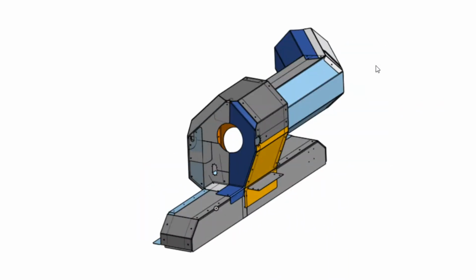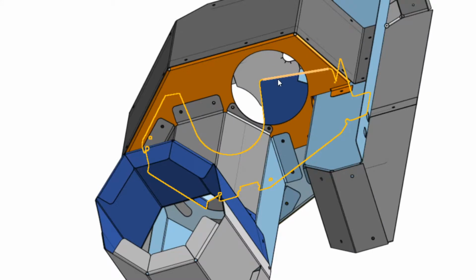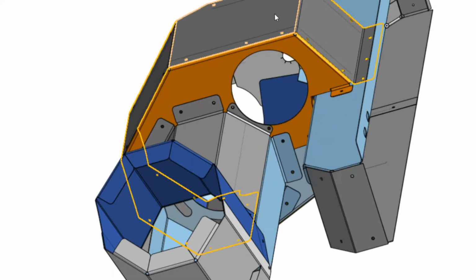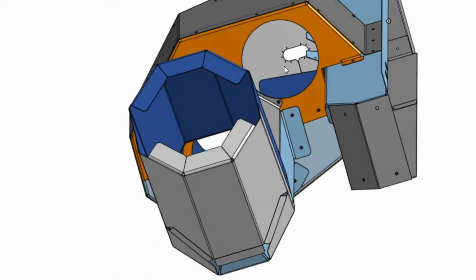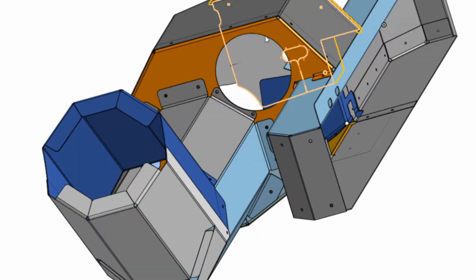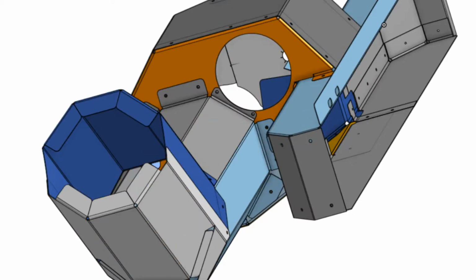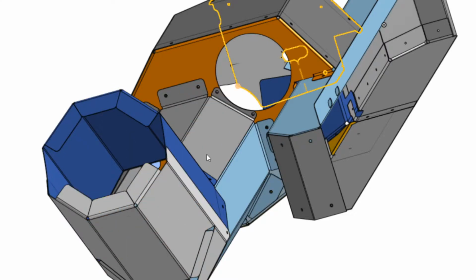Let's see, am I missing anything else? This system also has the air entry hole on the side of the turbo exhaust turbine cover. Normally I would put it on the top, but then we're usually a little bit lower back here. We had to extend this up higher to get over the wastegate actuator, and so it's just easier to come in from the side. Our air is going to enter from down underneath the muffler anyway. We're going to come back here and make a turn under the muffler and come in here to the side.